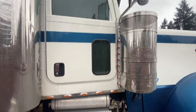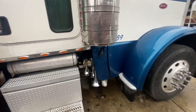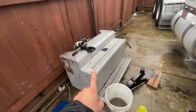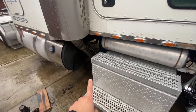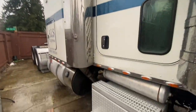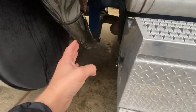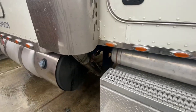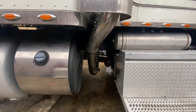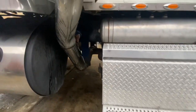Little by little we'll get there — it's a big project. Since we mounted this smaller step, we can finally mount a nice 90-degree picket elbow, maybe like an 8-inch stack, and do 114s all the way up. Because with the old step it went too far out and would not allow us to run that 90-degree elbow — as you can see, this elbow swoops to the side. So we needed more space over here. Mounting this step now gives us a lot more space to run a good exhaust stack.